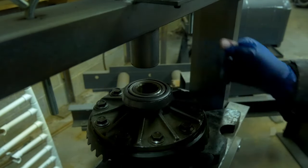Your original nuts you want to discard. You do not want to put that back on the differential when you go to reassemble it for its last and final time. There is a situation where you would use that old nut, but it's to measure the initial pinion preload, and that's it. We need something to torque it to 137, I believe, to 154 foot-pounds of torque, and then take the measurement without the seal on, according to the factory service manual, which I will have a link for in the description. If you don't have an FSM and you need all these specs, then there's one available to download. Just click the link in the description and go get the one you need.